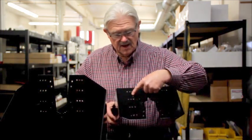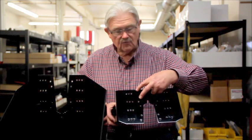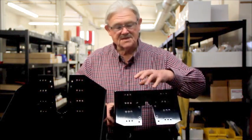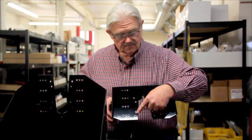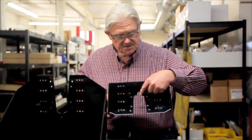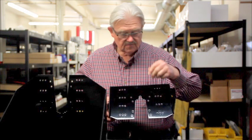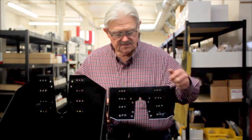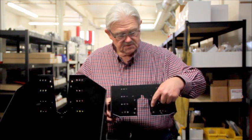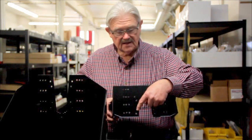This is a Dolphin fin. It's got a number of rows of mounting holes on the left and right side. These three rows of holes on each side are for the no-drill clamp set that goes with the fin, or it can be mounted with the no-drill clamp set. There's a cutout here that is notched or stepped in the back to fit different widths of spines on the rear of the motor. Those that are really narrow can just center on this slot, and those that are a little wider can center on these cutouts. There are also mounting holes along the side for bolting the fin on directly if you want to drill through the anti-cavitation plate and bolt it on.